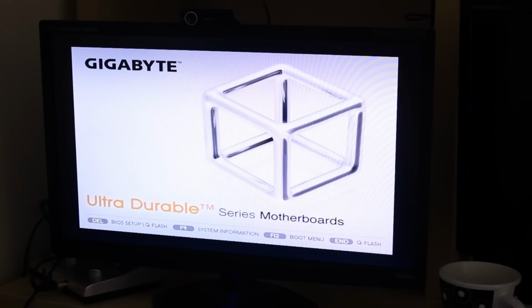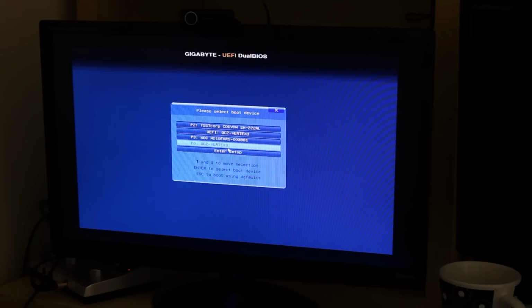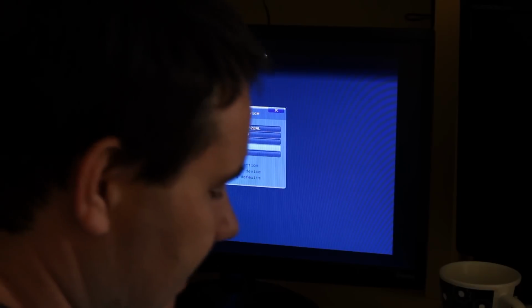Yeah, it's gone. Now what's going to happen is I'll just turn the computer on and off while I'm talking. I'm going to do it again, but this time with a different command. What's happened there is the install screen was actually there, but you just couldn't see it because the screen had turned off. Now I do know in MultiBeast 5 I think they're going to sort this out so that it auto detects your card and puts the command in for you so this doesn't happen. But for now, on my card, Asus GTX 550 Ti, I've got to boot from my, I haven't found my USB stick.